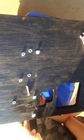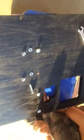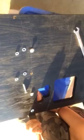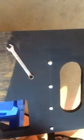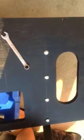Once again, these braces are going to support the front part of the wooden floor. It's at a 45 degree angle. It's basically the rest of the front floorboard behind the gas and brake and clutch pedals. It actually matches the angle of the firewall. Pretty much like Henry Ford intended.